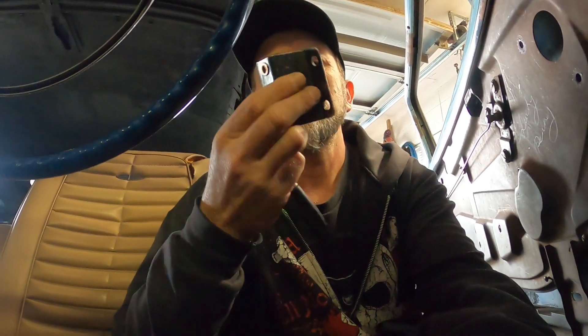I'll put it on the firewall toe board area and mark it up. I was going to use a Sharpie but there's black edge primer on there now, so I need a white pencil to mark it, then grind a little bit of that primer off so I can do some plug welds. I thought about bolting it but I don't want nuts and bolts on that side of the firewall. If you haven't subscribed yet, hit the subscribe button and notifications bell.